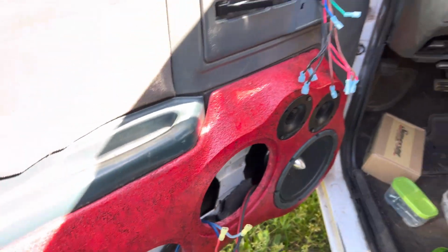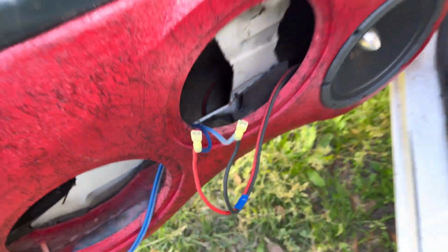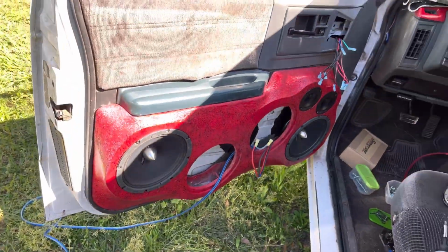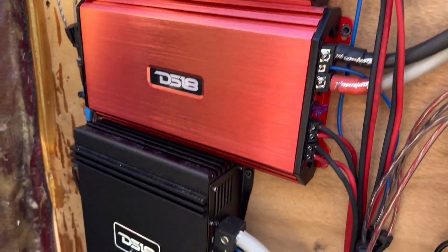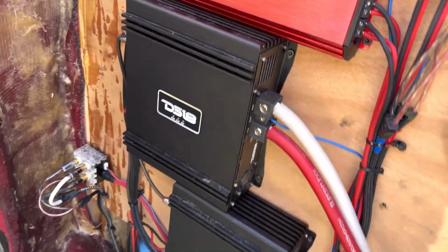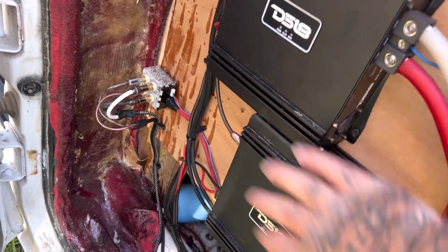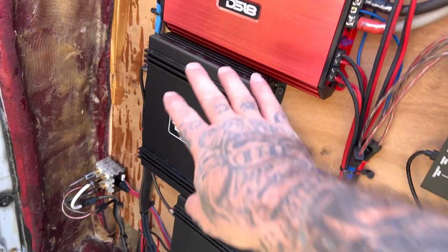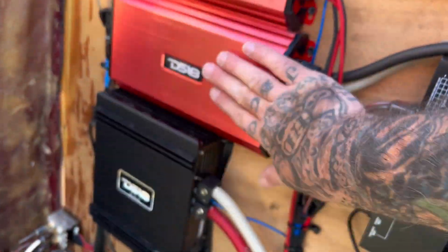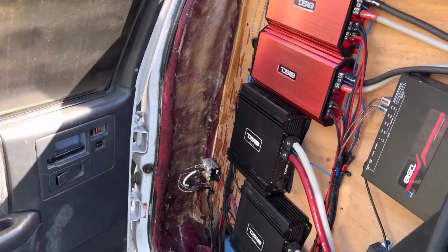And I had to find a wire code because, like I tell y'all, you got to have a wire code to separate them channels. So I had to know which one was the horn channel originally, so I could come over to here. Yep, that's the bridge that ran the horns, and run it down and find the wire code. And that ran tweeters. These are the two 3Ks that are coming out, and we'll put that GFX 8400 in here, and it'll run all the eights, tweeters, and A pillars here probably. I don't know yet. We'll figure it out, guys.